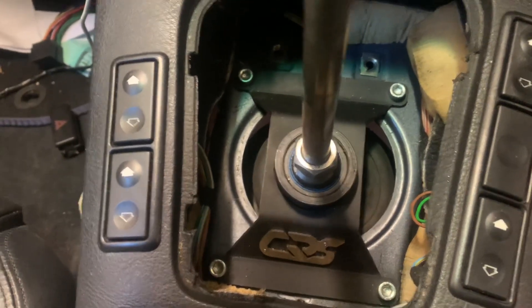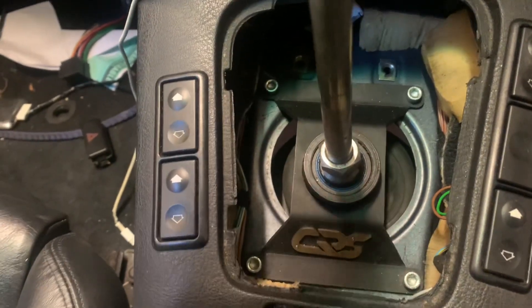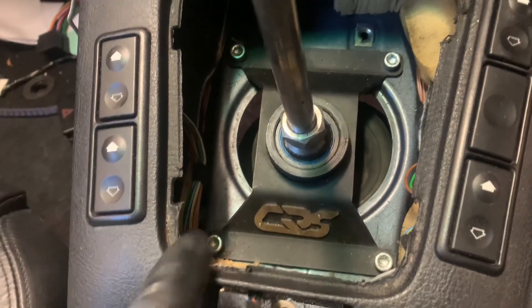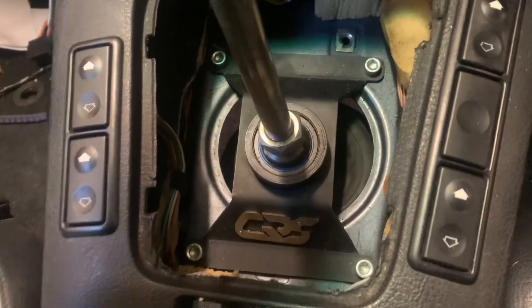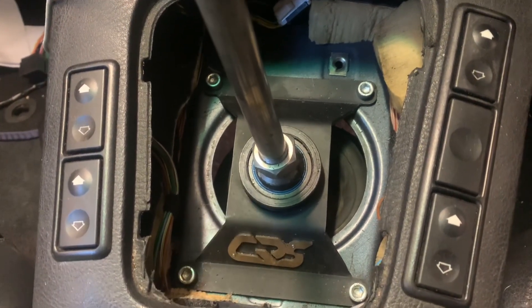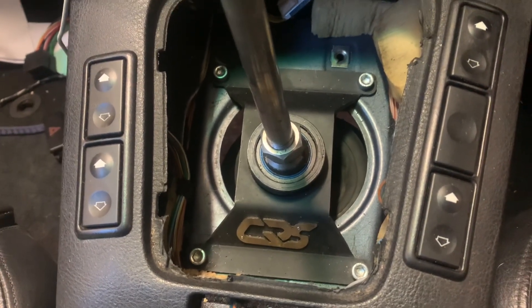What your chassis mount wants to look like when it's mounted — put your four holes, make sure your shifter is central to your hole. You need to drill these four holes, get it where you need it, mark it with a pen on your four holes, and then you can take this out and drill — I think it was 7mm.